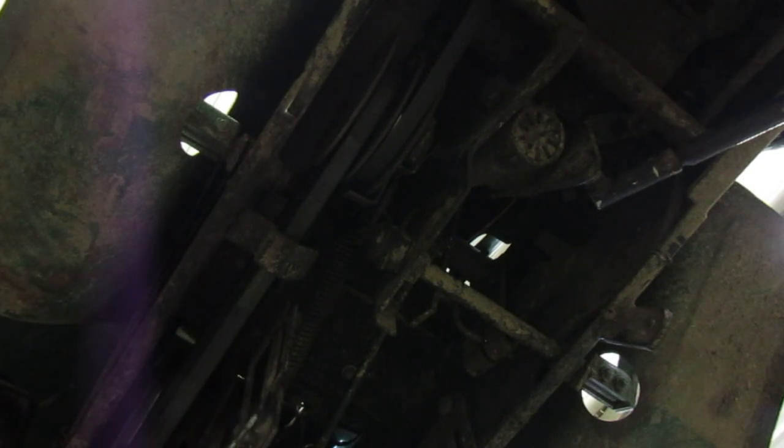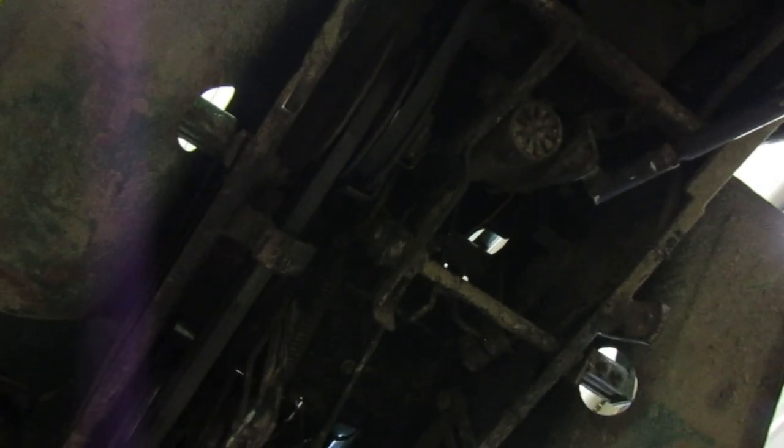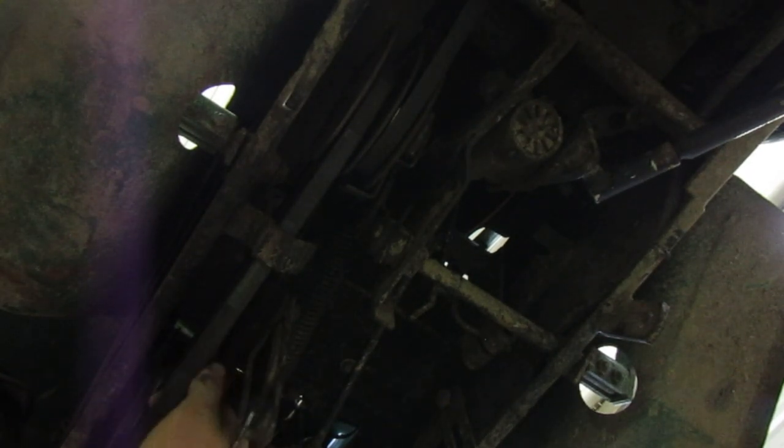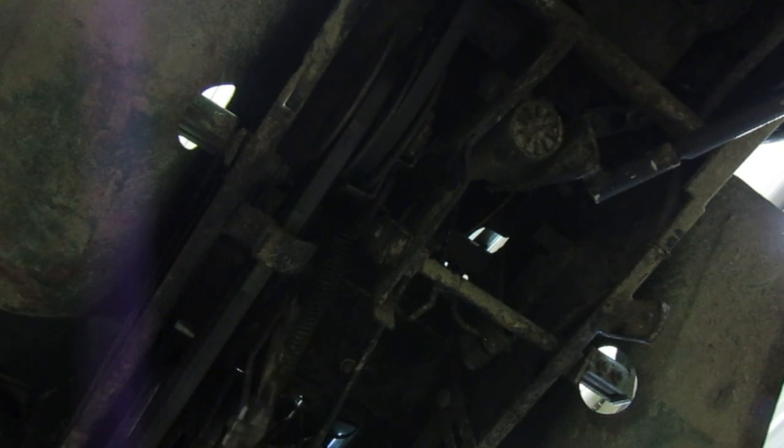So, that's fine. I've considered trying to tighten the variator down, adjust the variator like you usually would, but I've done that before and it doesn't seem to work. Well, I don't know what to tell you, because that is loose. That's looser, but it does turn this, so surprising enough. I'm sure when it's driving, it'll tighten down, but I'll move you guys back. We'll drop this thing down. We'll try adjusting the variator. I want to see if that does anything or not.